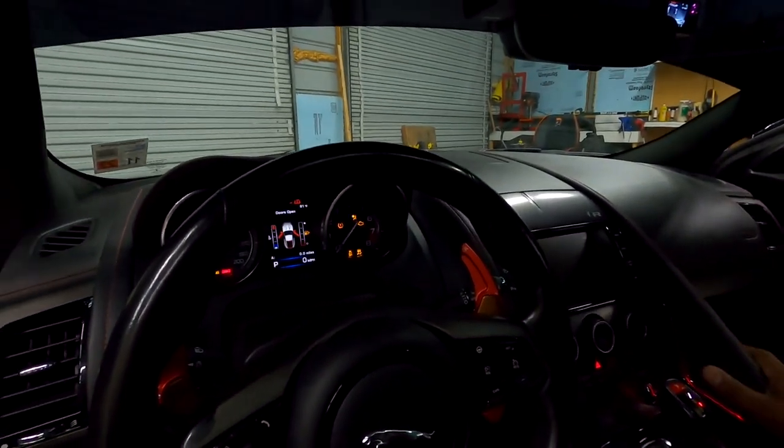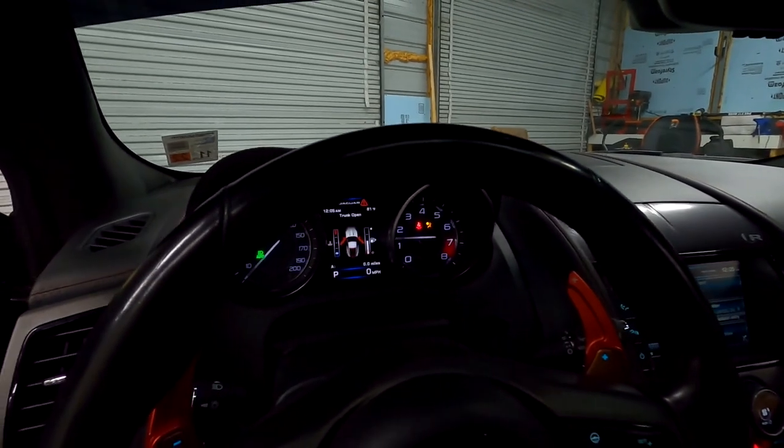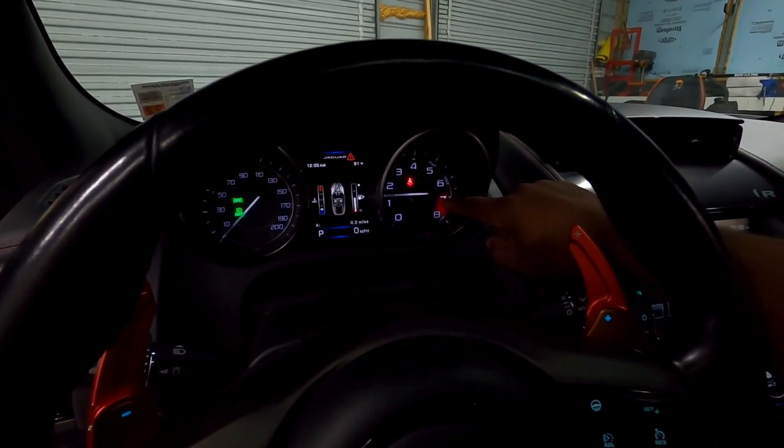Okay. So I didn't clear the codes. Well, plug the battery cable back up, put the fault reader on there, clear the codes in the ECU, and start the car up. Didn't see any issue. Let it run for a while, cut it back off, and I'm gonna start it up again for y'all. Seatbelt light gone. Check engine light gone.